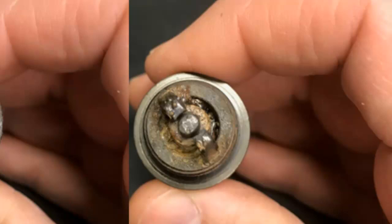If you can't get it done in one or two attempts, you need to taxi back and have a mechanic come out and pull the plugs and replace them. It doesn't take very long. They can be cleaned with a little bead blaster machine — that's a mechanic thing though. It is allowed under preventive maintenance, but I recommend that you leave that to an A&P mechanic. It's super critical that you get every last little piece of bead blasting material out of there, because if one of those comes loose inside the combustion chamber it's going to really wreak havoc. So we'll leave that to the professionals.